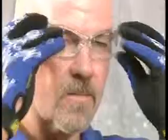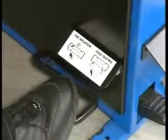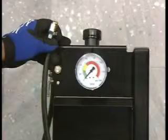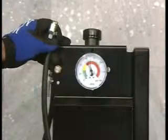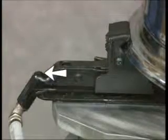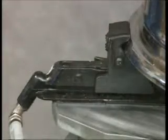When operating the bead seater, it is mandatory to wear safety glasses. The bead seater inflator pedal is on the left side of the machine. Press halfway down and air will come from the inflation hose end only. Swiftly press the bead seater pedal all the way down to get an air blast from the inflator jets located on the turntable. Air simultaneously comes out of the inflator hose.